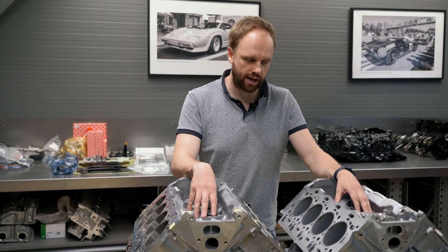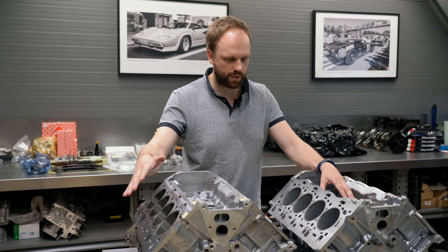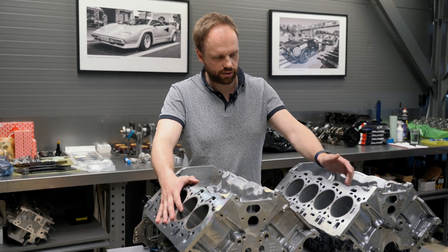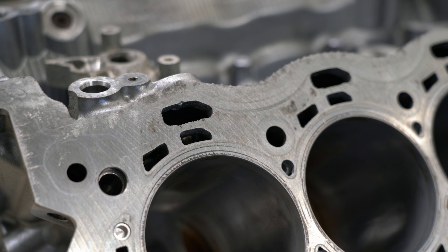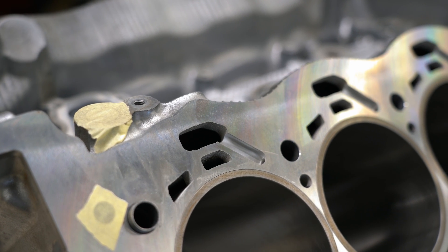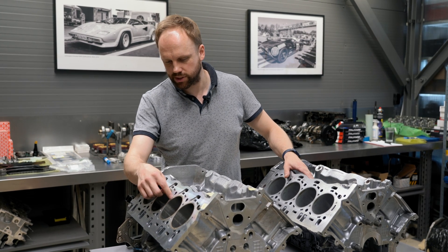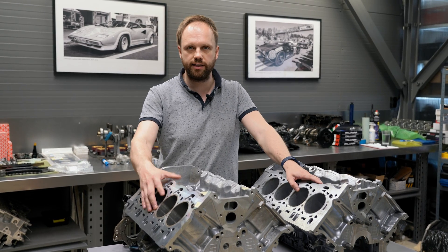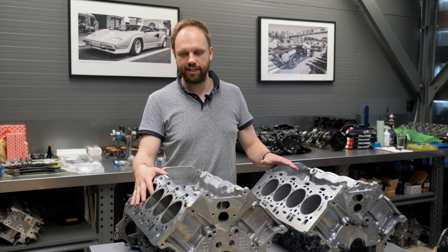M series cars don't have that heat exchanger. From the head side there are also some differences in how the cooling loop is routed in the front block-to-head junction. There are additional passages cut here, and the passages drilled between the sleeves between the cylinders for cooling are different on the F90 versus the N series — but overall the blocks are almost identical.